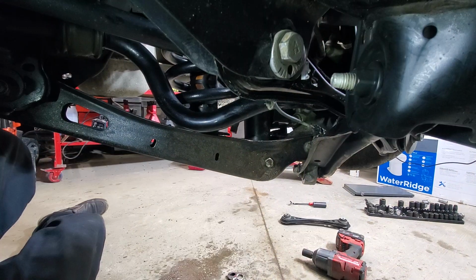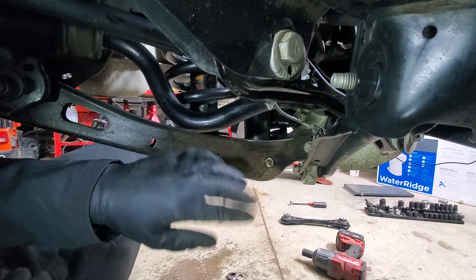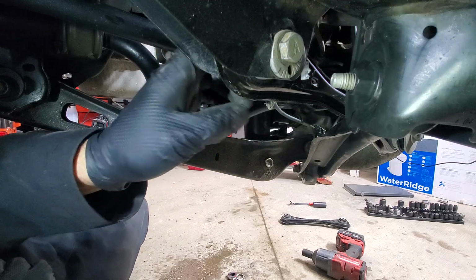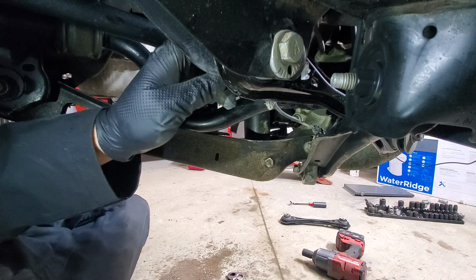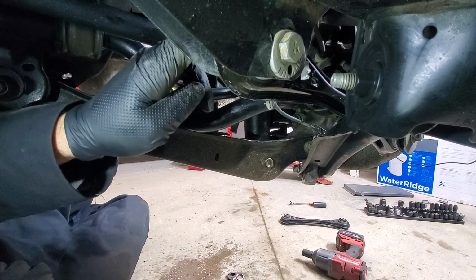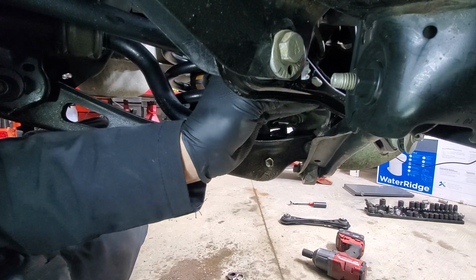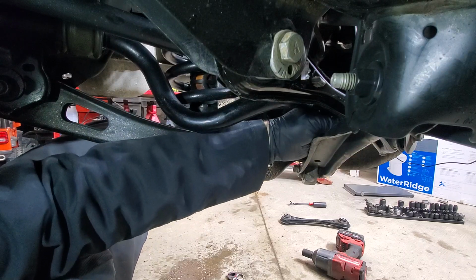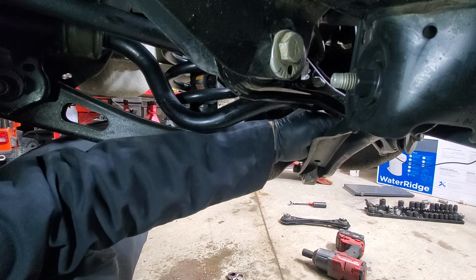Alright. Okay, so the last thing would be to torque those. Judging by the size of the bolt, those are M10 bolts. I would say we would torque it around 100 foot-pounds. Don't have exact torque specs, so don't quote me on that. I guess we will install that wire harness for the ABS cable into the slots on the link,